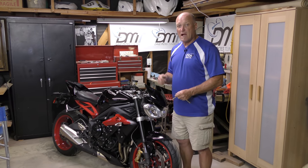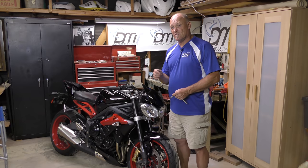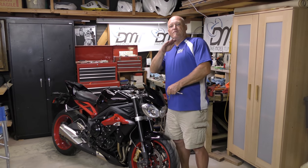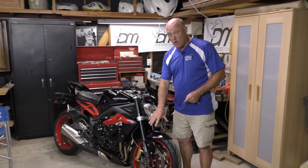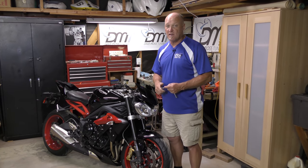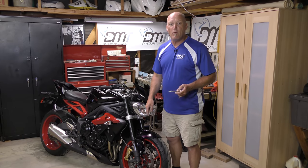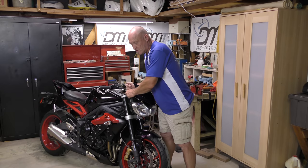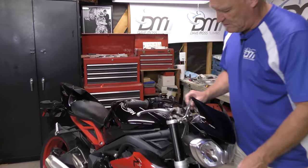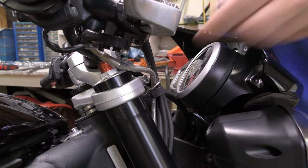At this point, my test with zero preload and very little compression shows we're bottomed out. I'm going to change the fork position by reducing the amount of black showing — I want the front a little taller. I'll try that first because I know the engineering is pretty soft anyway. To start, loosen the upper triple clamp until it's fully loose — literally wobbly, spinning by hand.